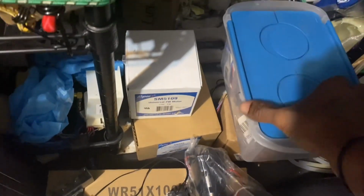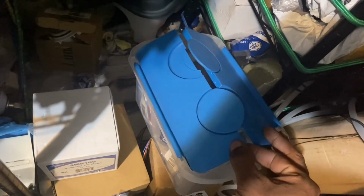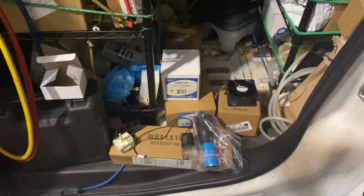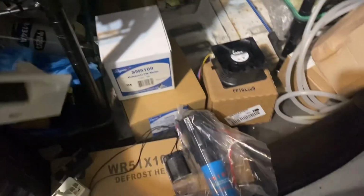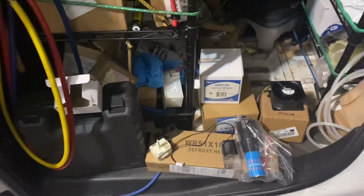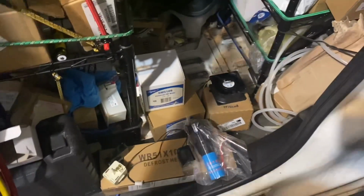Also, you want to keep a good amount of bimetals. Electrolux, GE, Whirlpool. You always want to keep those. Heating elements, depending on where you're at in your area, you'll get the heating elements, but the heating elements I usually keep because I run into them more than anything. I don't usually keep dampers too much, but sometimes I'll have parts that I know are good that I change through warranty, and I'll just have extra parts here and there.